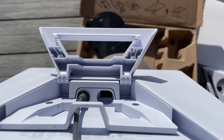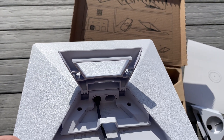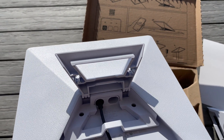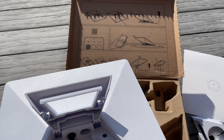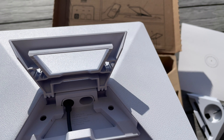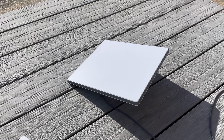One thing I didn't mention yet — there's a little plug inside covering this Ethernet connector, the RJ45 port, so you can output Ethernet right from the dish. That's quite convenient because the downside of the mini is that the Wi-Fi router is built right inside the dish. If the dish is far away on a pole, you can just run an Ethernet cable to another router or repeater inside your building. The only downside: that plug is a real pain to remove due to its shape.